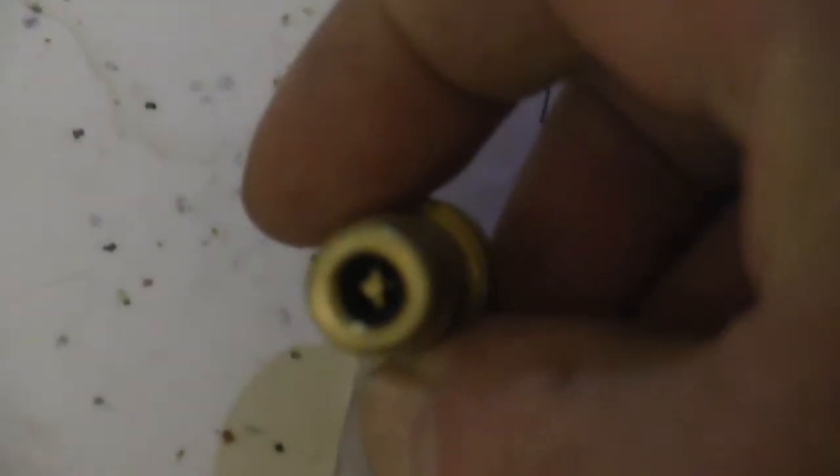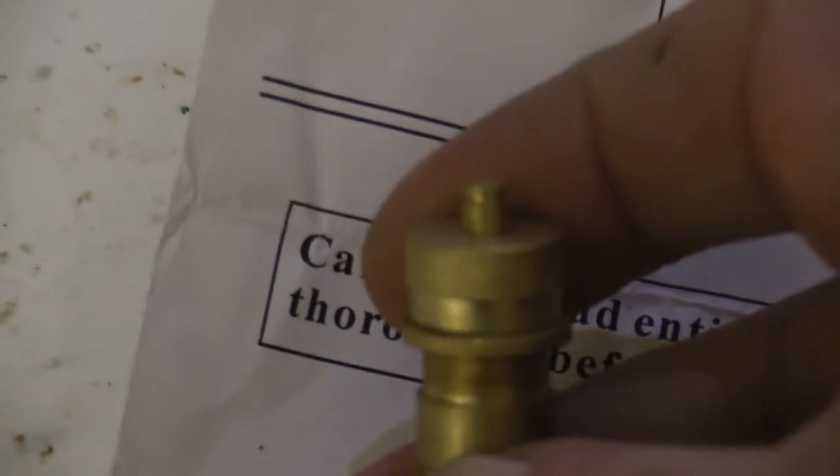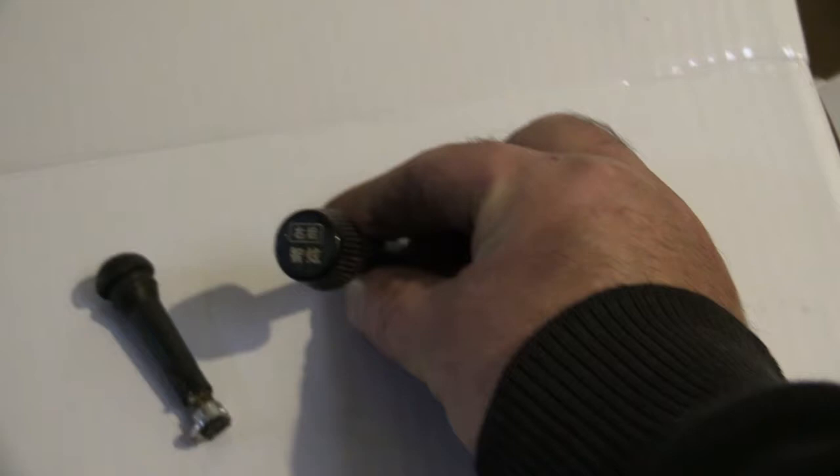You screw the deflators on the tires and drive for about 15 to 20 minutes until the tires are at running temperature. These things will adjust them to the appropriate pressures that you've got them set to, and then you can put the remote sensors on.